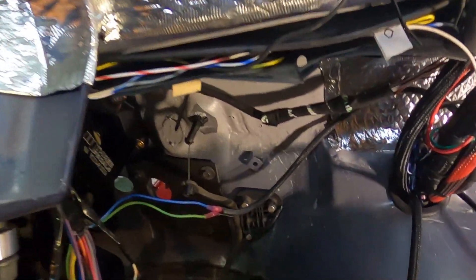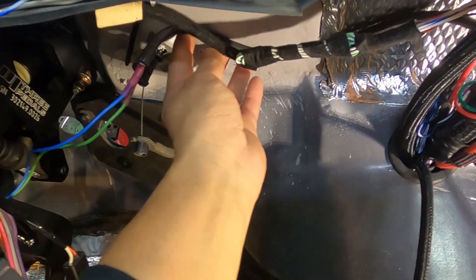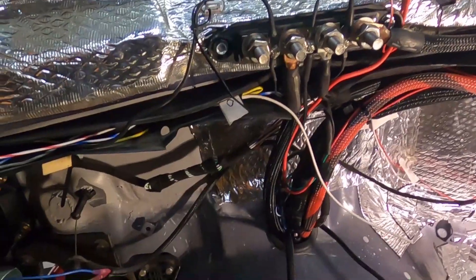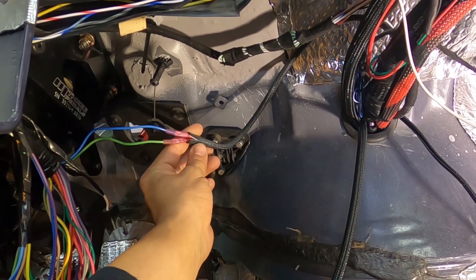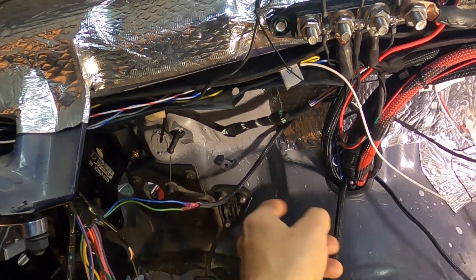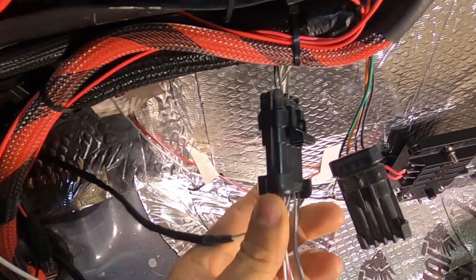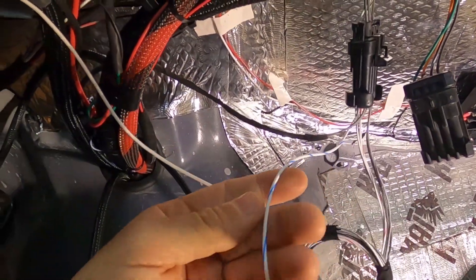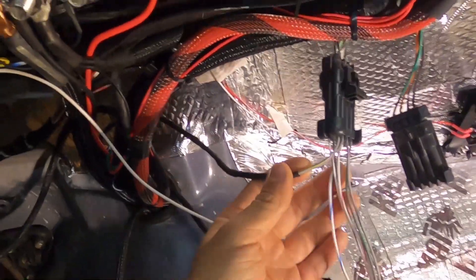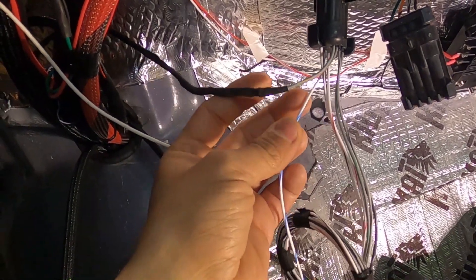That's really all you have to do — a few wires. We went ahead and left it visible so you can see what's going on; we'll dress it up and get everything zip tied out of the way. We've got to finish up the wiring for the steering column. The purple wires and yellow are left inside the wire loom in case we need them later. If you're not using Holley with GPS, you'll want to go to one of the inputs off the harness — Holley should have a pigtail connector. The blue and white wire I believe is an input, and gray wires are outputs on the Holley stuff.